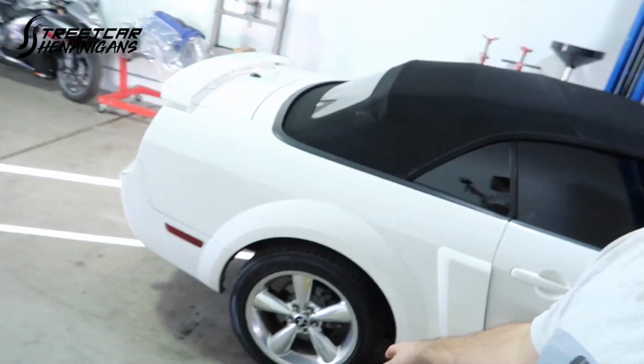All right, so the rear end is done on Sean's car. We didn't really show much of setting up in the back, but we set the backlash at like 13. Ford Racing told me to make it a little looser to try to avoid the coasting noise. But we're getting ready to start project number 2.